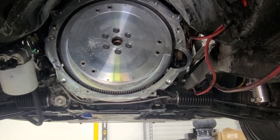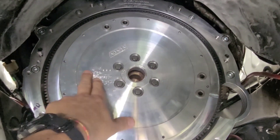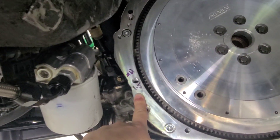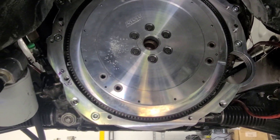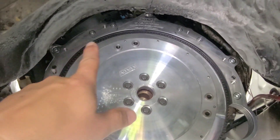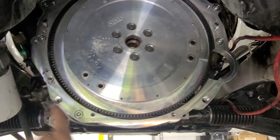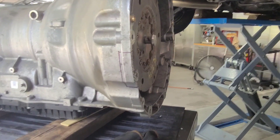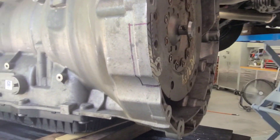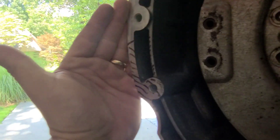Here's a look at what it looks like up in here. It looks rough because I hit it with a hammer a bunch of times, but it's not nearly as bad as it looks — this is soft aluminum and anything you touch it with makes a visible mark. One thing about this kit is it did not come with the M12 by 1.5 bolt — that's a really rare thread pitch for that size. I couldn't get that locally so I'm going to have to order it, and I do need it because I can only get a few bolts in this thing. A bunch of them I can't reach because it's too tight. So I've only got a handful that I've identified I can definitely get, which is making me a little nervous. Here's another look at what needs to be carved out for the starter snout to fit — that whole section including this rib, all where the hash marks are.